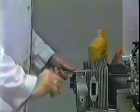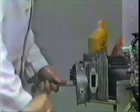Bring the torque up to 20 foot-pounds. Go back to the original side you began with and torque things to 20. Now the factory stock spec for torquing the cylinder heads is 22 foot-pounds. But I found that generally that's not quite enough torque. So what I like to see is somewhere between 25 and 27 foot-pounds. We've done that side to 20 foot-pounds, now we'll do this side to 20 foot-pounds. You go much beyond 27 foot-pounds, the washers, the head nuts start to strip.